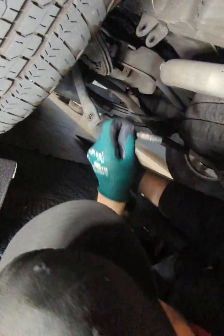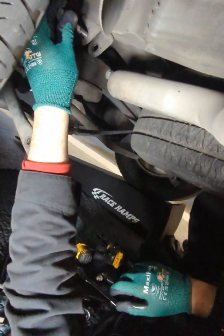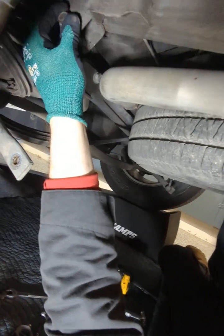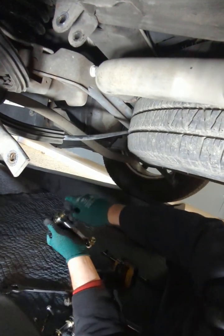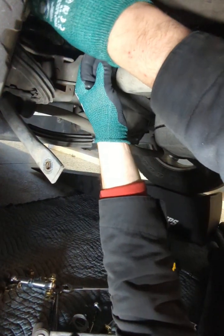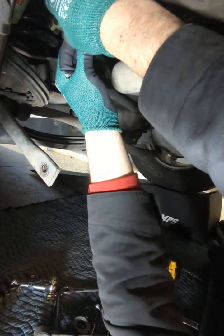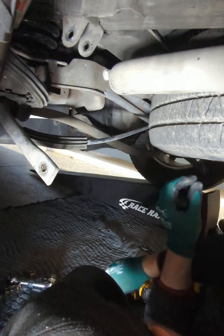So stock GM bolts, right? When GM makes these brackets, there's tons of play here. It just moves all around. I hate that, literally. So on mine, I have a grade 8 upgrade. That's a thicker shoulder. That literally gets rid of all that play. I mean, it's in there. So, yeah, let me start with the install on these real quick.